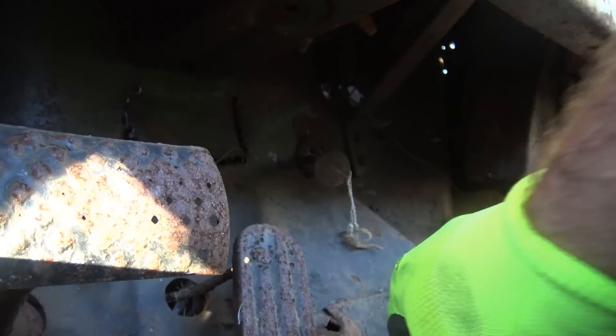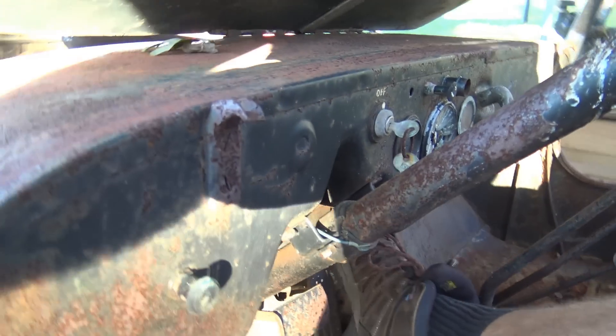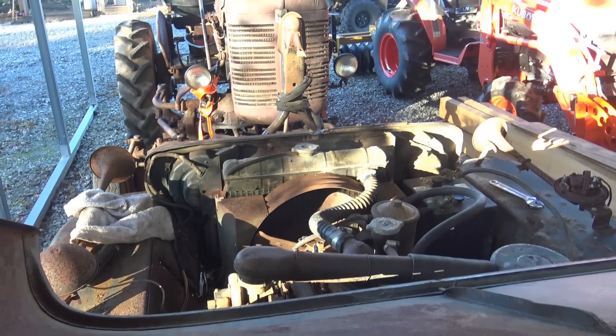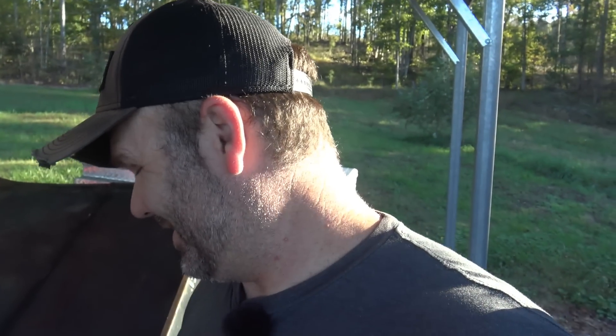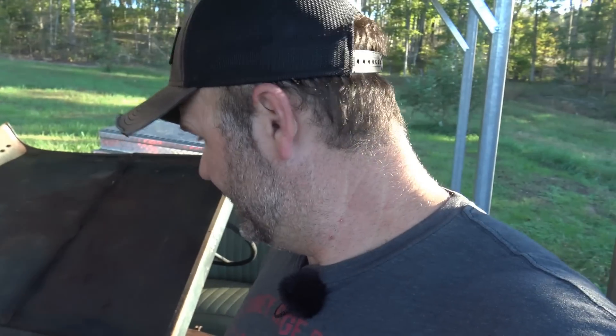Let's see if it'll turn over. So in these old Jeeps there's a start switch on the floor, like up under the floorboard here. So right here is what I need to mash to start the Jeep. I'm going to turn my key on and let's try it. Let's reach in here and give her a shot. Come on, old girl. It's turning over! The starter doesn't sound too hot. Now that there is a good sign — so it's turning over. It's not turning over very happily, but it's turning over and smoke is puffing up. So let's get our starter fluid and give it a shot.